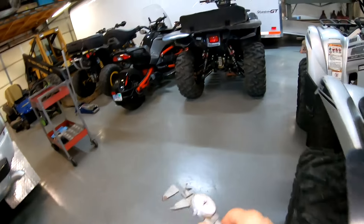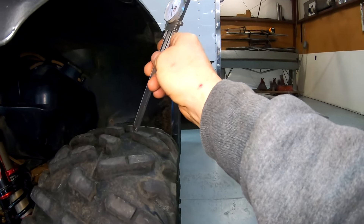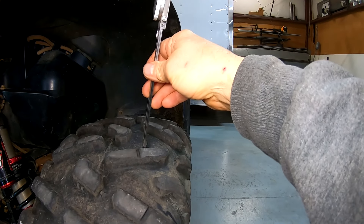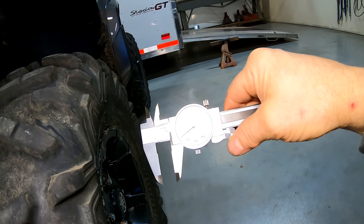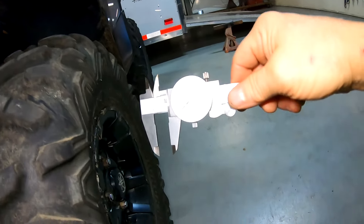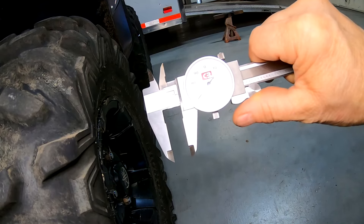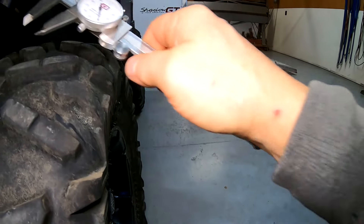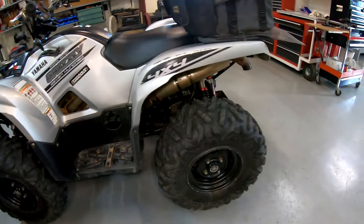We'll check the wife's tires too - they're probably going to be a little taller. They measured at about five seventy-five thousandths. So they've got about sixty-five thousandths - about a sixteenth of an inch - more tread remaining than mine, which you could tell just by looking. That's what you've got after four years.